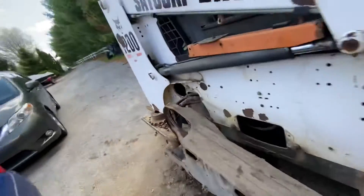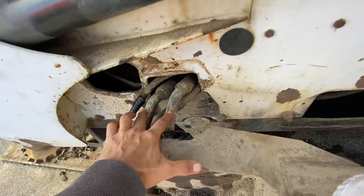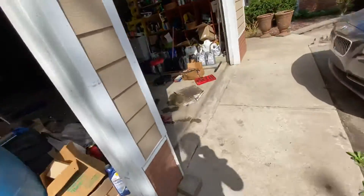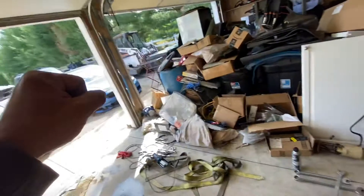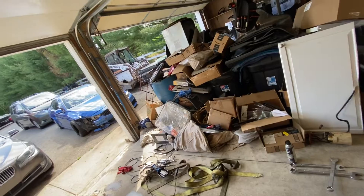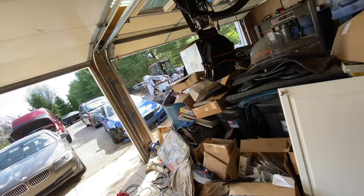What you need to do is follow these two big hoses right here. Of course you need to lift the cab up, and you're gonna see these two hoses connected to the pump. Just disconnect those two, plug them up with the caps, then start your engine and push the handle to go. If you hear your engine bogging out, that means your pump is good. If you push the handle and it does nothing, most likely your pump has failed.